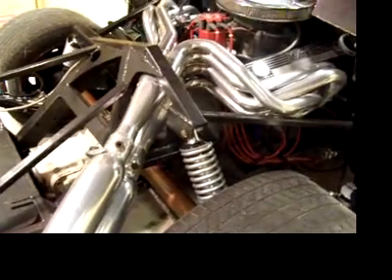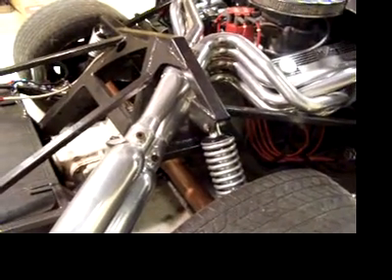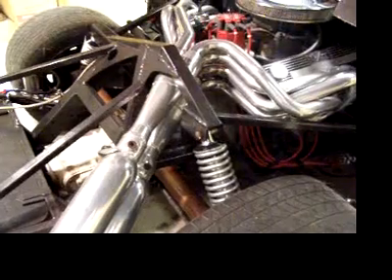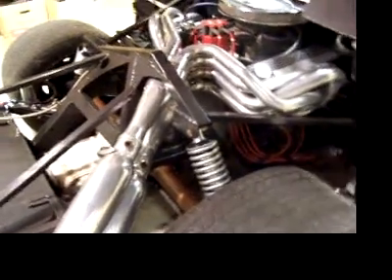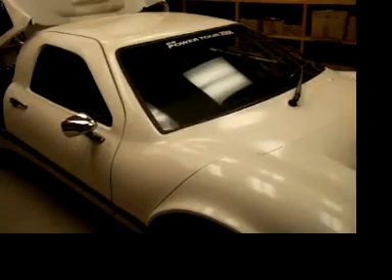180 degree headers take two pistons from each side of the V8 and go into one collector. So you need a much smaller collector volume because from the exhaust standpoint, this runs like two four-cylinders. And it does have a much higher pitched sound, particularly at higher RPM, which fits more with the style of the car — which is a copy of a late 60s Ferrari Dino.